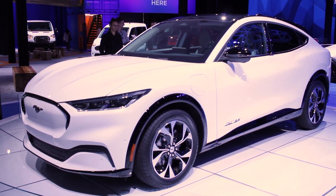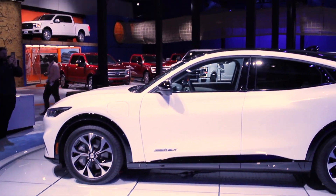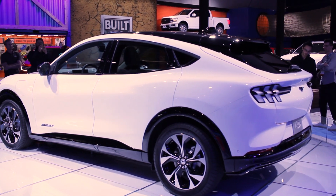Just running around doing errands, driving about 90 miles, not really fast driving, mild comfortable conditions. I want to see how well the battery heats itself up over the course of the day. Part of the reason is there was a recent piece on the Ford Mustang Mach-E where someone left the car basically unplugged, nearly empty, with overnight lows down into freezing, and they were surprised why they didn't see the rated DC fast charging rates after only driving maybe 20 miles to a charger. Well, that's just not how lithium batteries work. You can actually damage them if they're cold and you try to charge them too quickly. What he did was cold-soak the battery and then tried to DC fast charge it right away.